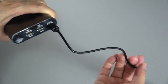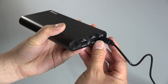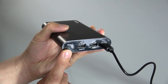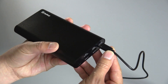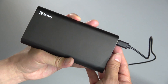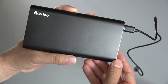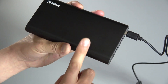That makes it quite easy, and that's how you charge it up. If you have a USB-C to USB-C cable and one of the new Apple MacBooks, you can actually plug this in and charge your MacBook. The way you change directions on the USB-C port is you hold the power button in for about three seconds — that'll activate the direction mode. The USB-C port can either charge a USB-C device plugged into it, or be charged by a USB-C device plugged into it. The LEDs will blink either three or four times indicating which mode it's in. The default mode out of the box is that when something is plugged into the USB-C port, it charges the power bank itself.